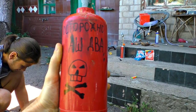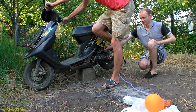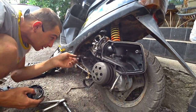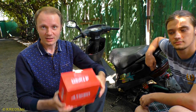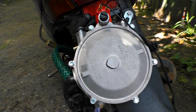Can a scooter run on hydrogen? First we will make it real and afterwards we're gonna show you if it's useful, save some money, and if it's comfortable to use hydrogen. Last time my experiments with the scooter didn't go well - all exploded. We fixed the scooter, something had moved so we put it back in place. This time we bought a car gas reducer; this will make the gas flow in the right proportion.